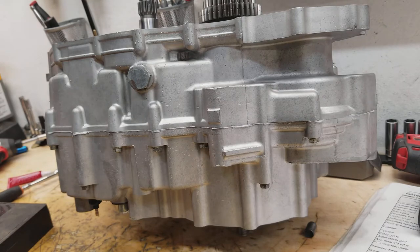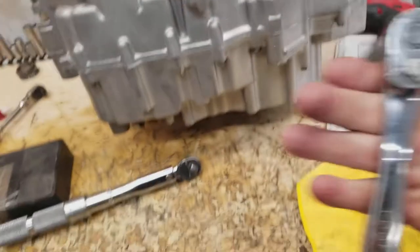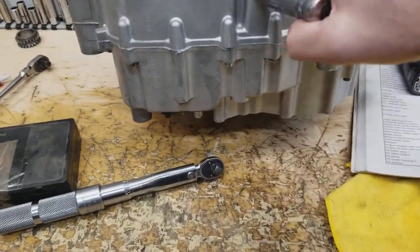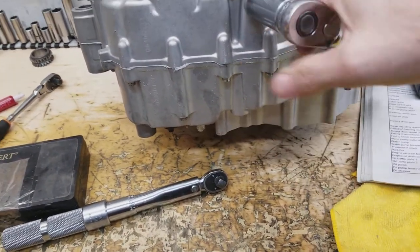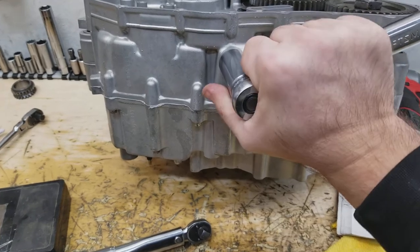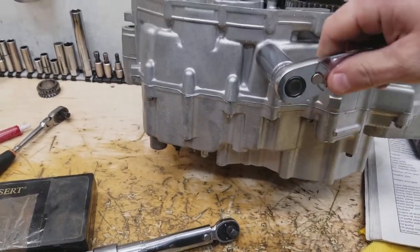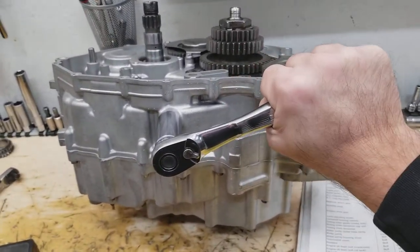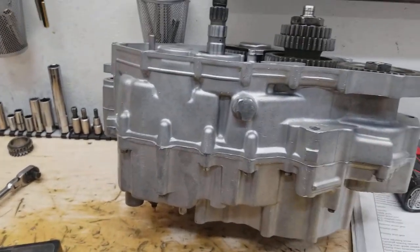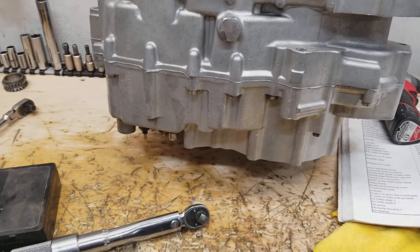What I'm going to do is put a small ratchet on the socket and see how tight it is by hand. If you take a ratchet and you just palm it — basically putting your index finger up against the socket — that's going to reduce the amount of torque you can put on a fastener by reducing the leverage. As it is right now, the strength of my wrist at that location, I can't move that bolt anymore. If I go out further I can get a little bit of turn on it where the handle is. So if you tighten this drain bolt palming that ratchet, that's going to get you pretty close to full spec. In my opinion, that spec is a little high for that material, but that's it for today.